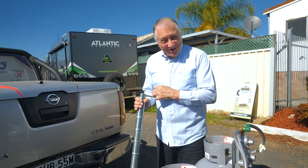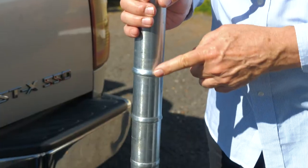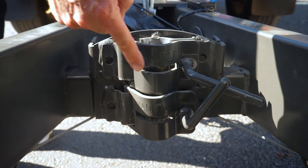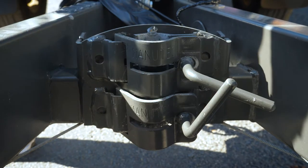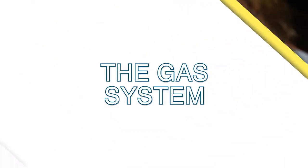It's essential to note when you're reattaching your jockey wheel that it can go various heights. You have these ribs, and these ribs correspond with these rib bracket holes, so when you put your jockey wheel back on make sure that the ribs go through the rib holes - that is absolutely vital.